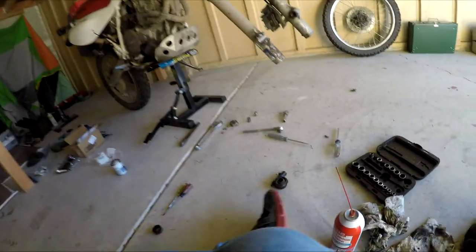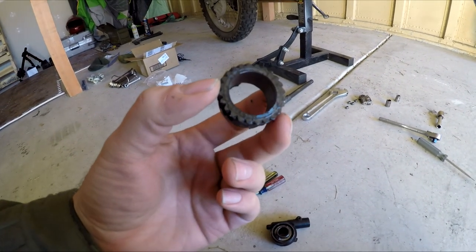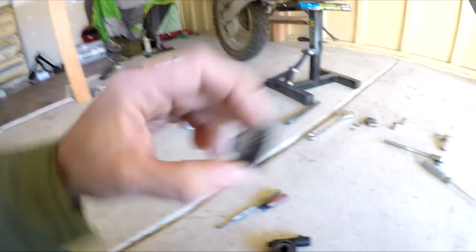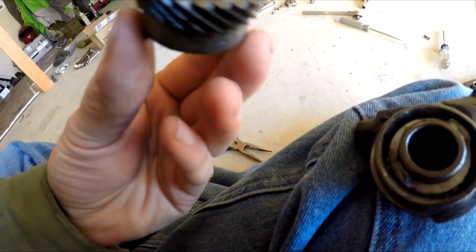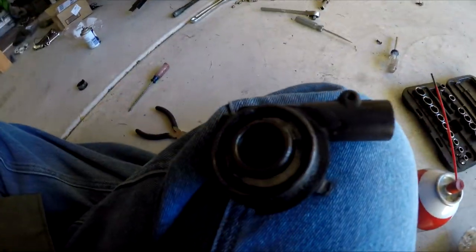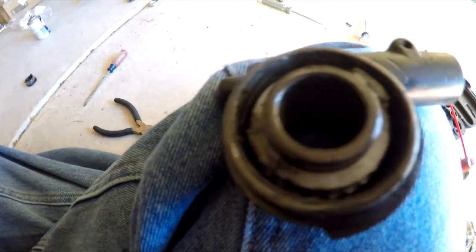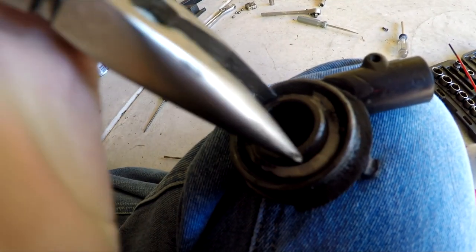Here's what I noticed: my old piece was a little different from the new piece — I don't know if that's just from age and running around in there. The old piece was worn down flat against the gears, while the new piece actually sticks out a little bit. I don't know if this is just worn down from like 20,000 miles or what. It's also stripped out at the top compared to the new one, although it doesn't look that badly stripped. I ended up using two of those Honda washers — I don't know if I should have done that, but I figured there'd be enough play in the system that it wouldn't hurt, and they were cheap.